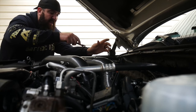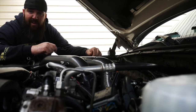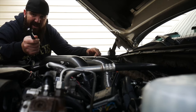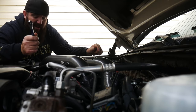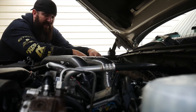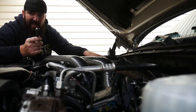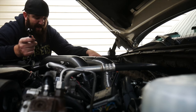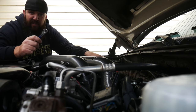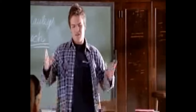All right. So before I go ahead and tell you guys that I'm unhooking the battery on this one, I want to make sure that I told you that I unhooked the negative post on the other battery as well, because if not, you go to take this positive one off of here and you set this positive cable on something else, guess what? The positive cable's still hooked up to the other battery too. So might as well, just for safe sake, if you're going to take one of these off, go ahead and just unhook all the cables from both batteries.